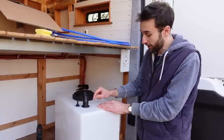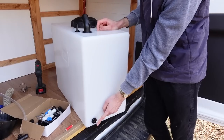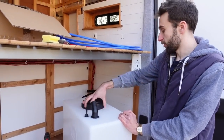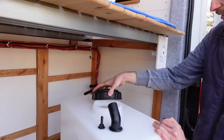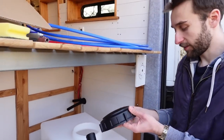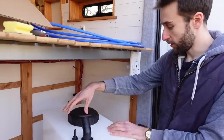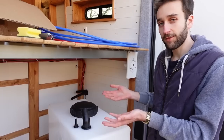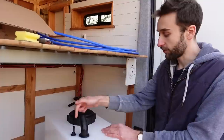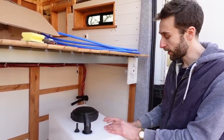We've added our three connectors to the tank: the inlet pipe, the breather tube, and the supply line that goes out to all the stuff in the van. The tank also has a nice access area so we can get in and clean it out if needed. We decided against a vented lid because if the tank is really full and we're driving, water could slosh out — so we've got the breather tube with a bit of extra pipe to help prevent spills.